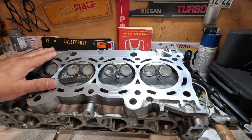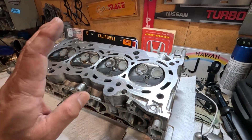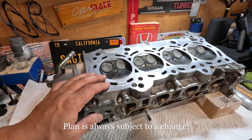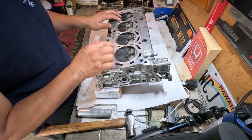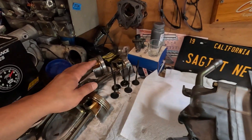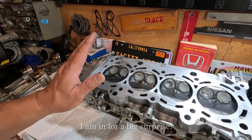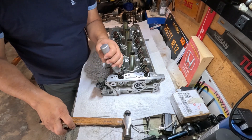It's something I always wanted — I try not to bring my parts to any machine shop if I can; I try to keep it in the house. The only thing I need to do is remove the valves and check how many are bent. No worries though, I already have a replacement — I got five of those. If there's any more than one that's no good, everything is taken care of. I have all the parts on the cylinder head, so we have a go.